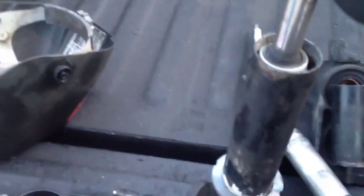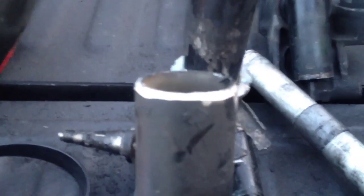So basically, with a chop saw or whatever you've got, you've got to cut that section out and then weld it back together. I actually did one before I ran out of welding gas and decided to buy a new chop saw. Here's one right here sectioned — it's not finished welding, but I was putting the spring perch on. With it cut and sectioned, that new strut is going to drop in there so that the cap will hold it in place. That's the hardest part — cutting, chamfering the edges to get a clean weld.